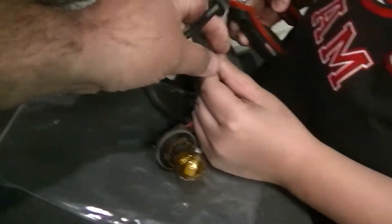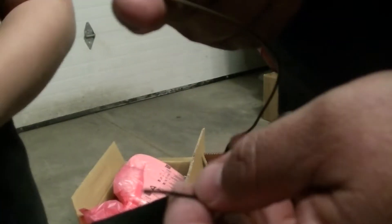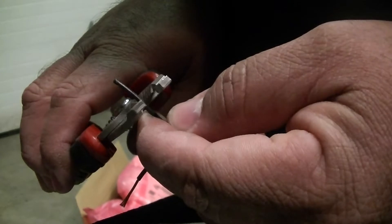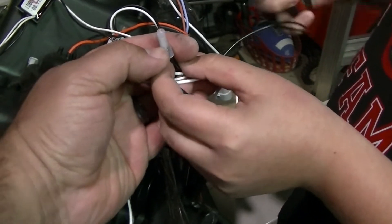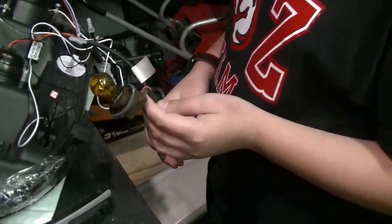Just in case we ever need to reattach this, all we have to do is remove our old wiring and then use some butt connectors to put it together and it'll be good as new. Now that we have access to these two wires, this brown is going to be our positive cable and this black is going to be our negative cable. We're going to strip these back a little bit — just enough so we can have a good connection. We're going to do the same for all of our negative cables. Now we connect it to the harness — make sure that cap is all the way down and then squeeze right there as hard as you can. With the connections nice and tight, it's time to test.